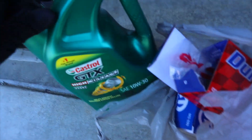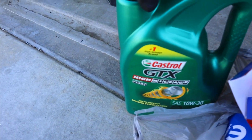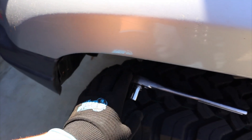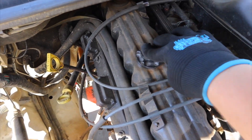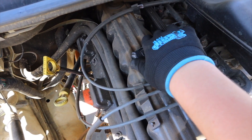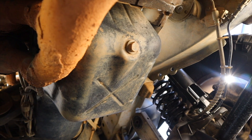I've been using conventional oil, but we're actually gonna change over to a synthetic blend. And to make you guys happy — Mopar filter. You need a 16 millimeter socket to remove the bolt underneath. A common thing on these is the cap — it breaks. I actually replaced mine, I think I got it from AutoZone and it's a lot better than the stock one. So we're gonna loosen up the cap and also loosen up the drain bolt to get the oil out.